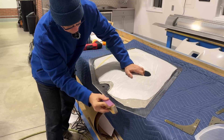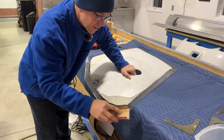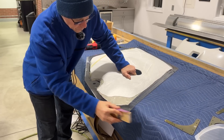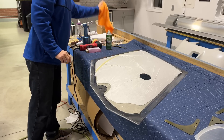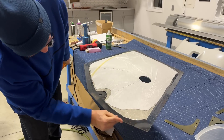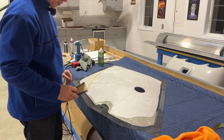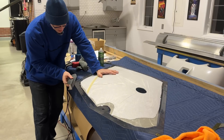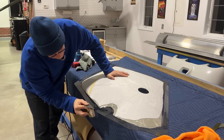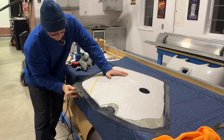So I'm getting the edge of this one. Now wipe off the dust, and now we have a real nice smooth edge. I've done the 320 and 400 all the way around, and now I'm going to do the last step here of 600. I'm not really sure it's necessary to go to 600 because it's pretty smooth with 400, but I think the 600 will really just give it a real nice polish and it only takes a minute to do.